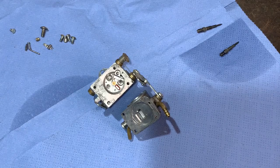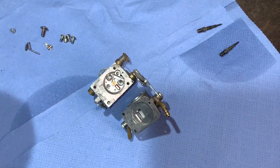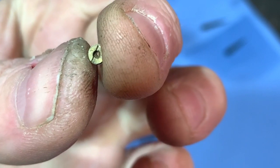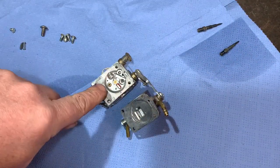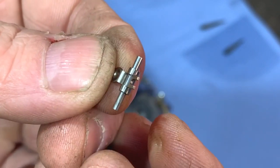The carburetor has been all cleaned. I'm going to get the parts back into the carburetor and then we can fit the new diaphragm and gasket. Firstly I'm going to put this little jet back in — it is clear, you can probably just see that through there. So we'll get that back in first. Now that jet's back in, all good.